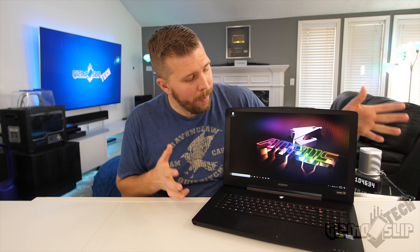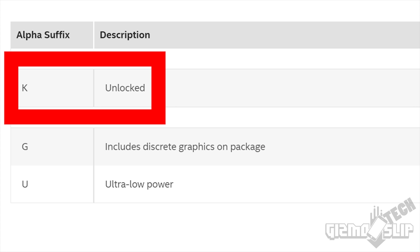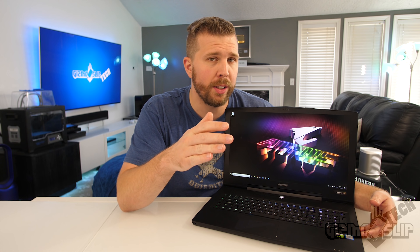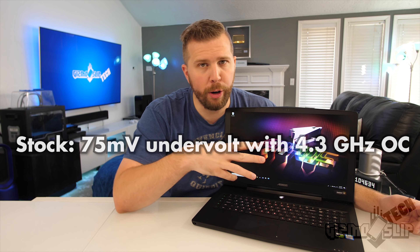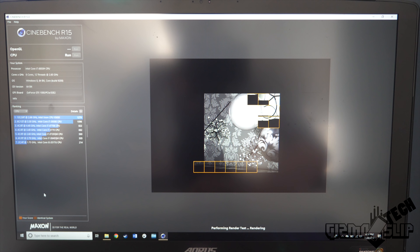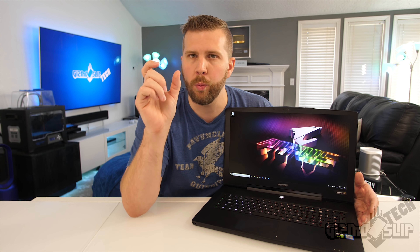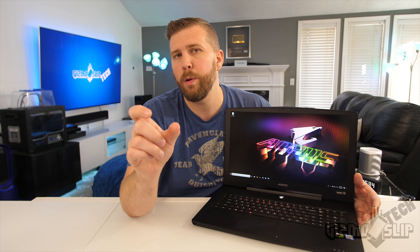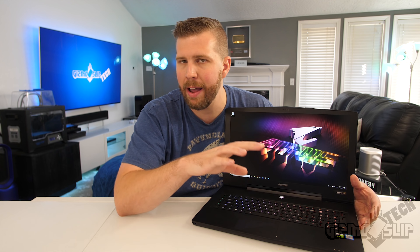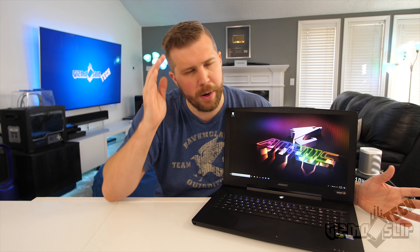Let's hop right into the performance. The i7-8850H is actually very overclockable. Traditionally, CPUs with the K lineup in the name are overclockable, but you really can't go above 4.4 GHz like you can with the i9-8950HK. Out of the box, AORUS undervolts this by 75 millivolts and it's overclocked to 4.3 GHz. Under heavy CPU loads like benchmarking or rendering video, it won't consistently hit 4.3 GHz because it becomes power-limited to only 63 watts. This is easily bypassable using Intel XTU — I set the undervolt to negative 125 millivolts without issues, though 140 was too much and caused crashes, so I kept it at 125.